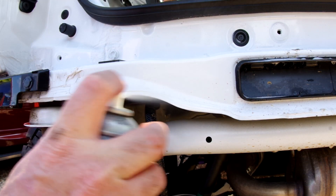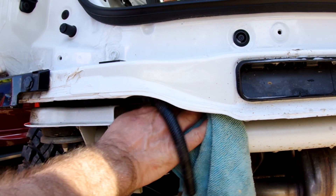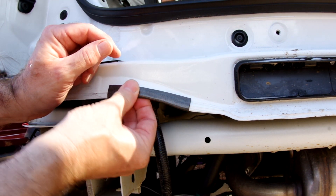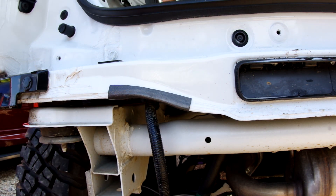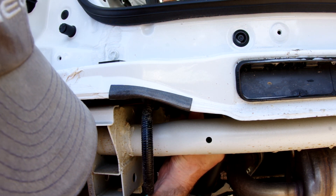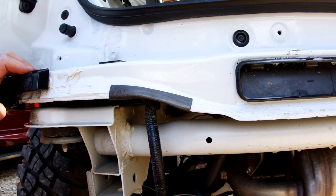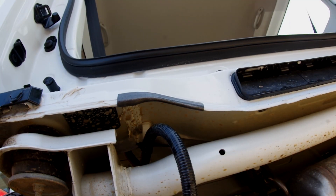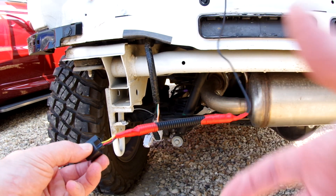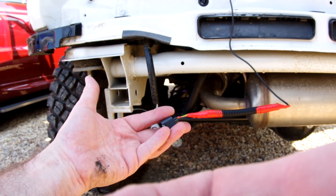We now have to fit the wire in here. They recommend cleaning the surfaces with an alcoholic cleaner to make them nice and clean, ready to take some foam strips. These are stuck into position on the outside edges of the metal and on the inside where there is another metal edge — this is to stop any cables from fraying on the metal when they vibrate in the car. Here I am putting the rubber strip onto the inside edge as well. The rubber strips go across the edges of the metal panel mouldings to stop fraying. Then take another piece of plastic sheathing and wrap it around the end of the lead that is going to be pulled through the car.